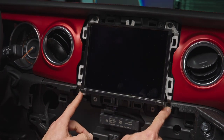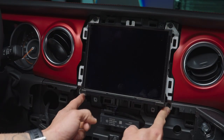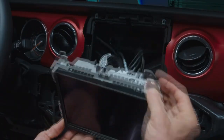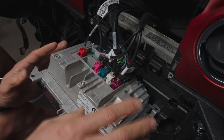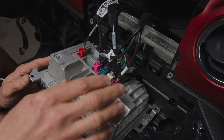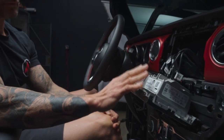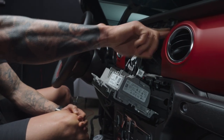To remove the head unit, there are four screws in the surrounding brackets. Remove those four screws and the head unit comes right out. The back has more clips than you may be used to from older JK models, but they are color-coded for the ports. It's not necessary to remove the head unit to complete the dash removal, but we'll do it to ease removing the surrounding panels.